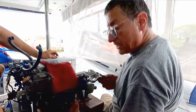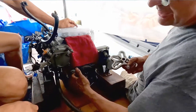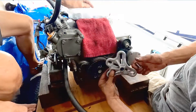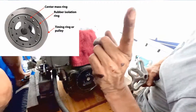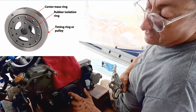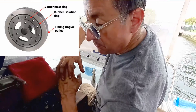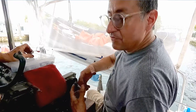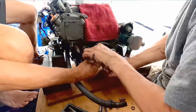We are going to use the harmonic balancer puller to remove the harmonic balancer. Be careful: if you use a puller with external legs like this, you will destroy the aluminum. The appropriate puller is this one. Never, never use a puller with external legs because you will break the external side of the harmonic balancer. Additionally, some harmonic balancers have two rings — one external ring and one center ring — with a piece of rubber in between. That rubber acts as the harmonic balancer, allowing the external ring to move relative to the inner ring while the motor is spinning, absorbing excessive momentum. That is why it is called a harmonic balancer — to absorb harmonic distortion.